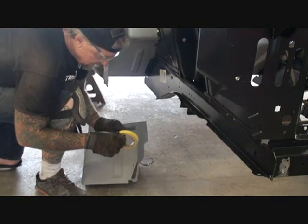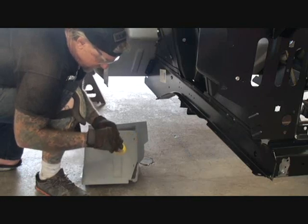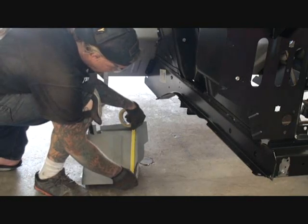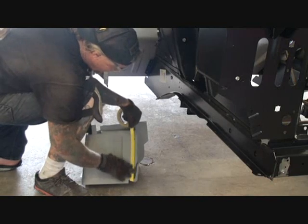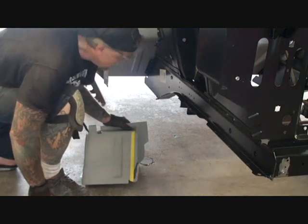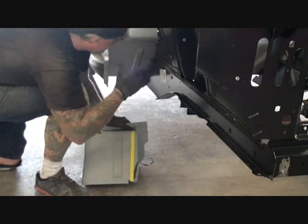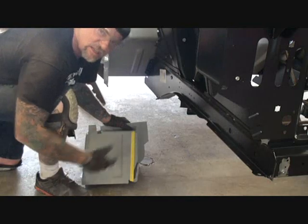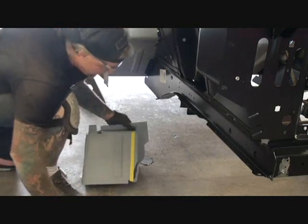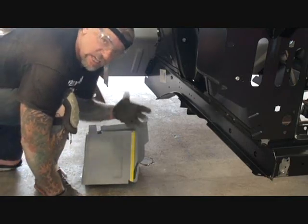So I'm going to take my tape to make sure that I cut a nice straight line, and then we'll go ahead and remove all that right there. I just want to let everybody know that if you are not replacing all this and all you're doing is replacing these torque boxes, you still have to trim these down. So there's another tech tip from my friend Pete to you.